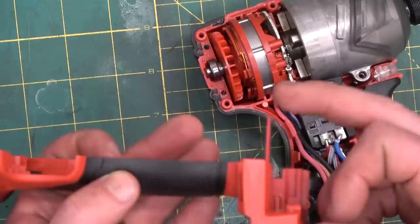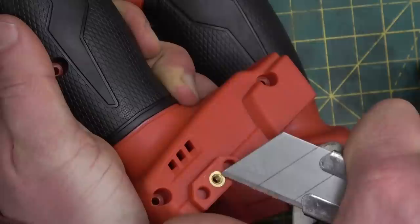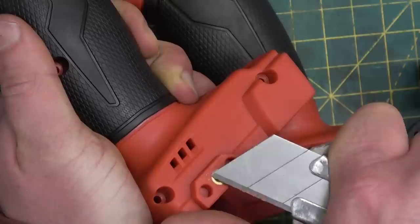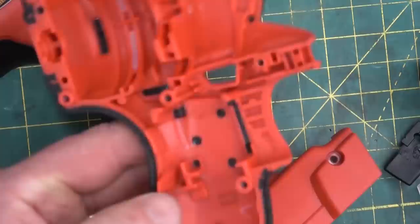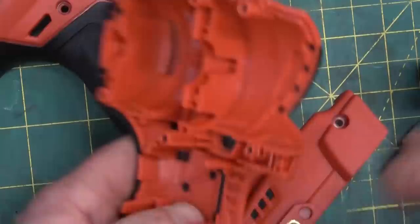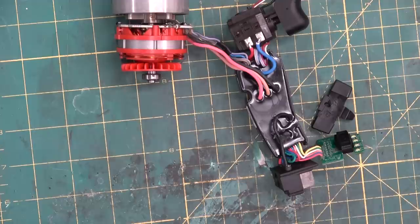This is a nice part and very likely the most expensive bit of plastic you'll ever see. There's a little brass insert for the sky hook — and it looks like it hasn't been heat-welded in after the fact; it's actually been molded in there, because there's some flashing over top of it just a wee little bit. Beautiful detail. They added two pins so that your sky hook doesn't weeble wobble around if that fastener gets a little bit loose. The bore for the bearing — tiny little bearing but quite a bit of material there in nylon in order to strengthen it up.